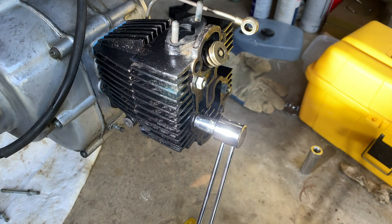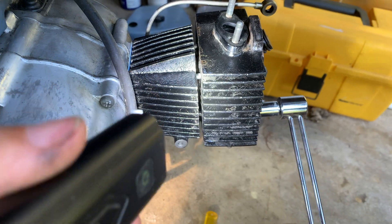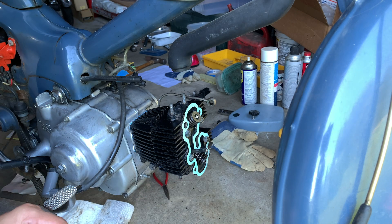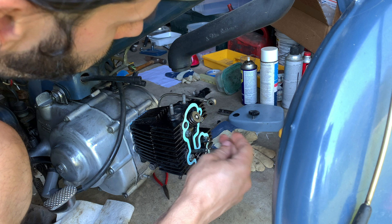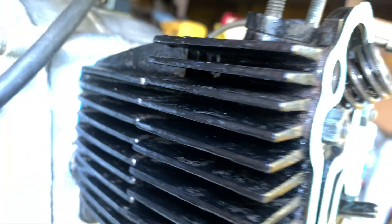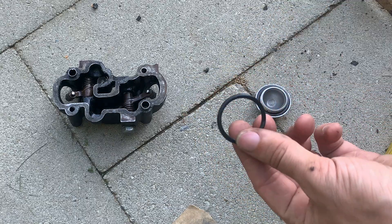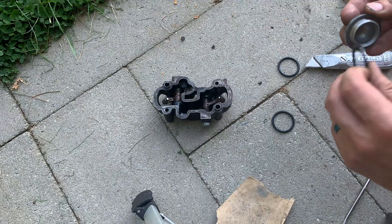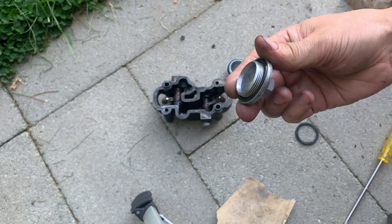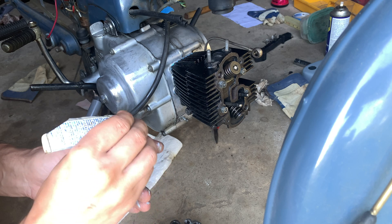Do at least three tightening passes getting tighter and tighter, because you want it to slide together evenly. I'm using the torque wrench because otherwise I would have no idea how tight it should be. I put the push rods back in — the longer one is on the bike's right. The last of my rings in this kit go on the valve covers. Because the gasket was so stuck on there, I'm putting anti-seize on this one — I should have done it for the first gasket but I forgot.